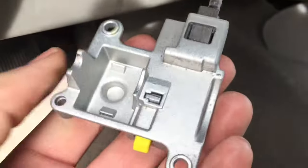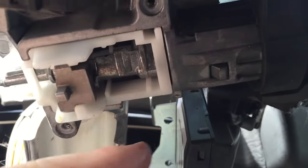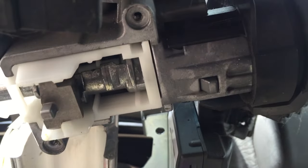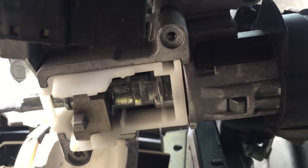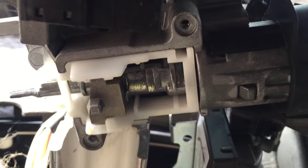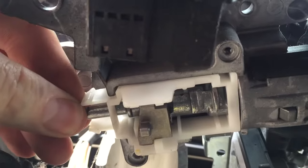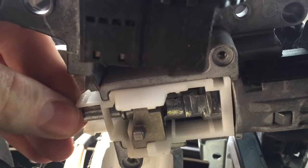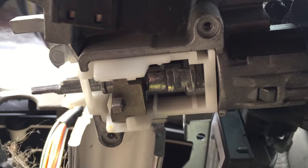This here is our shifter interlock and it sits underneath the steering column. You'll see it's got a couple of screw holes — one over here and one up here. These are also security Torx 10, so you've got to have the security Torx 10 to get to it. I've just dropped this down out of the way — there's our ignition switch actuator. I need to go ahead and get this out of here and get the new one in. It's got some particular alignment issues. That's the shorter how-to for getting it out and what specific tools you need.